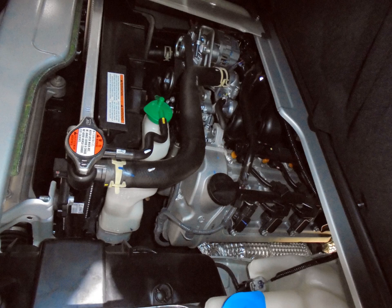Used in Suzuki Aerio and Suzuki SX4 (up to 2009). J20B — 2.0 L, 1995 cc (121.7 cu in). Coil-on-plug ignition, VVT. 150 hp (152 PS / 112 kW) at 6,200 rpm with manual transmission; 148 hp (150 PS / 110 kW) with CVT.